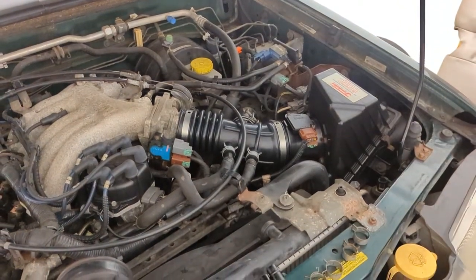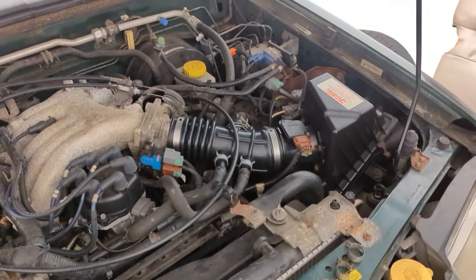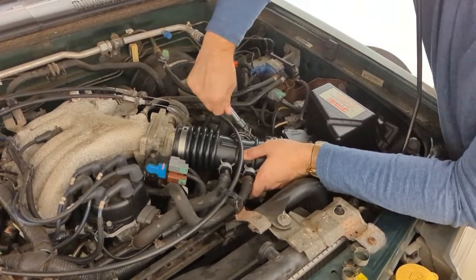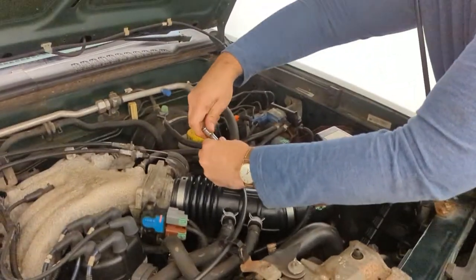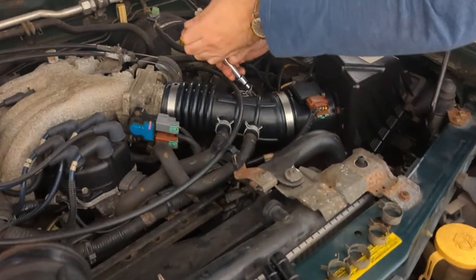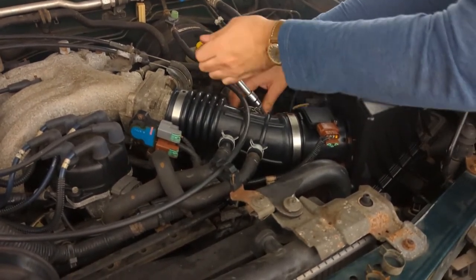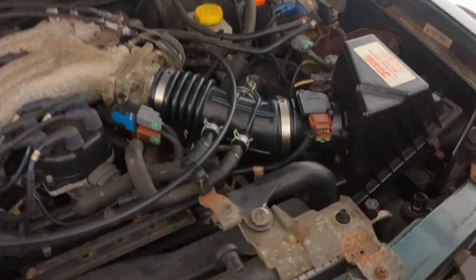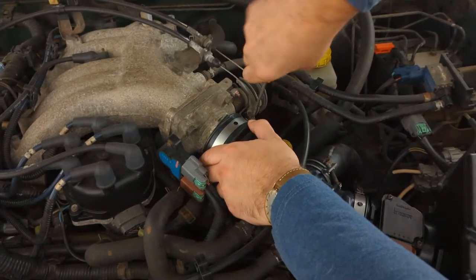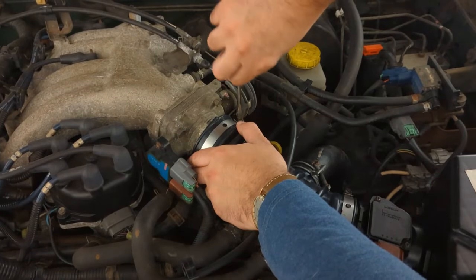The air injection is probably the most difficult one to work with. You want to keep your orientation for your screws somewhere accessible for you — it's definitely more helpful if you're able to access these. Angle it towards you a little bit. Pull the clamps down if you can so you don't move it around too much. With these worm drive clamps, you can use a bolt — not that long, obviously. Let's see if anything will work. I know what to do for my secondary air injection. You want to keep these tight, but you really don't want to crimp them too hard because you really don't want to break these lines.